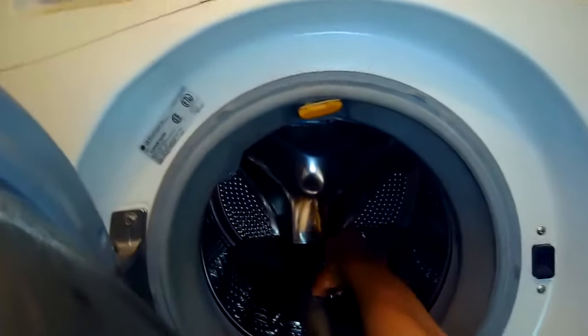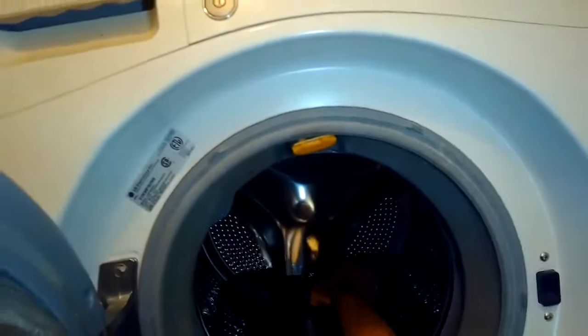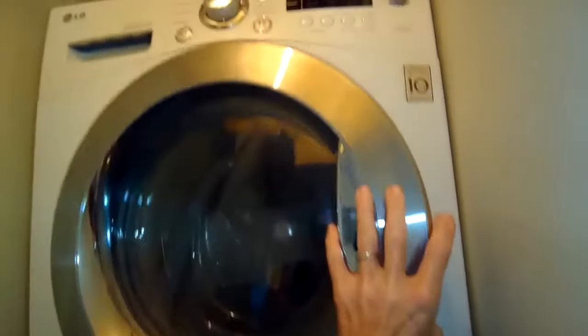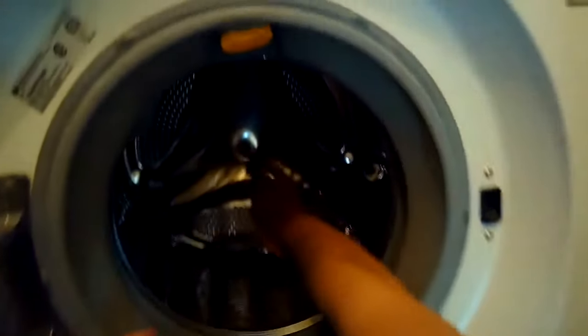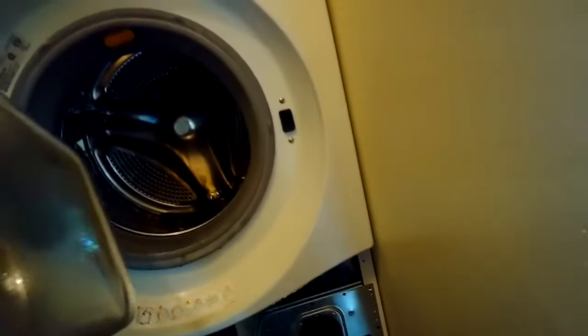We tilted the machine back to about 45 degrees up against the back wall, and that's so we can bail out the water that's remaining that didn't pump out. And also this takes the water away from the pump. If it's down horizontally, then you'd have to put a clamp in or something, or it'd be a real mess. But by tilting it back and bailing out the water, then there's very little water that will come out at the pump. So it makes it a lot easier.